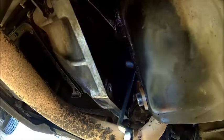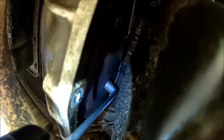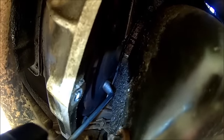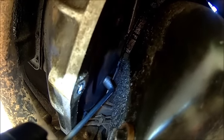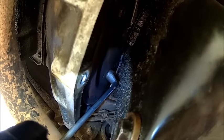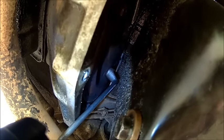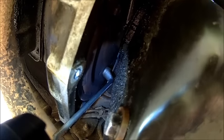I think we're lucky because we found one loose bolt here. These are the slotted flex plate bolts, and this one is completely loose. So I think we found our knocking. We're going to take those bolts out and loctite them in, because otherwise they may come loose again. Hopefully the flex plate isn't cracked. I haven't seen anything so far — I'll turn it around and have a look.